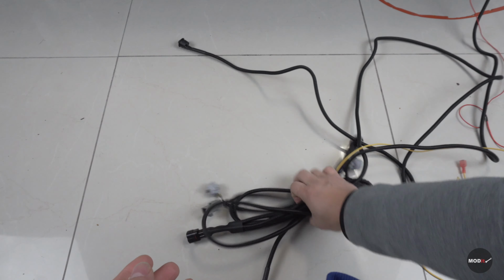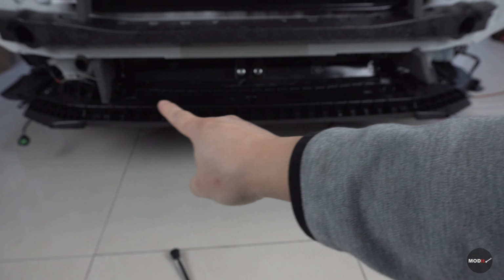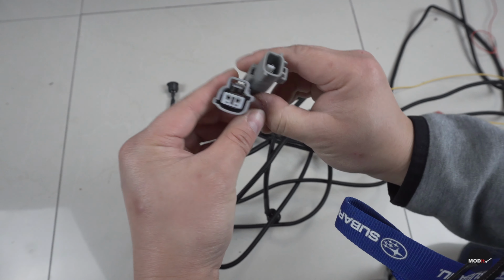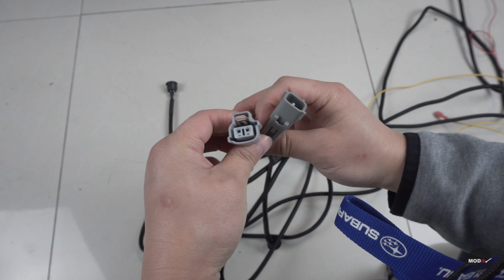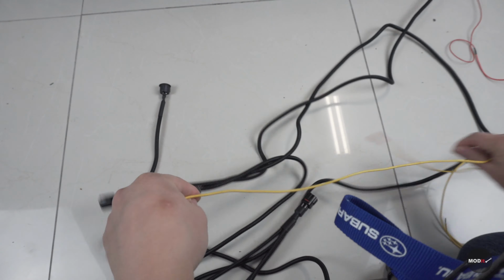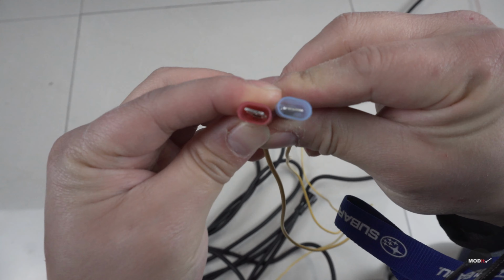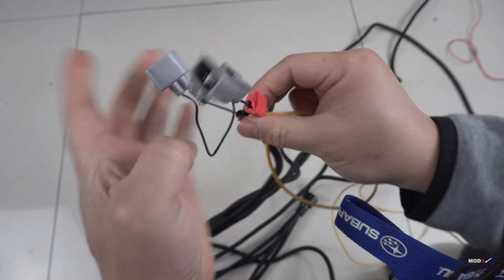This harness, and then put it onto our car. From there, run alongside there. So for those of you who have a WRX that has a turn signal at the bezel, you can use these plugs. But my car, the 2019 Limited, doesn't have those turn signals at the bottom. So what you're gonna have to do is make your own two wires like these. Can you see it? These ones. Make two long wires and then splice that wire